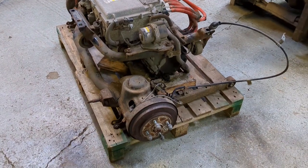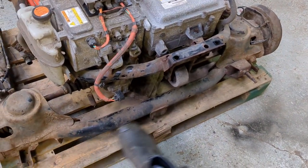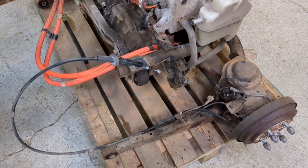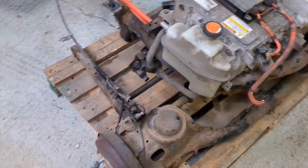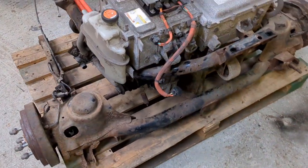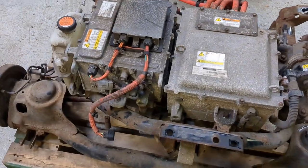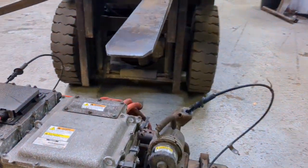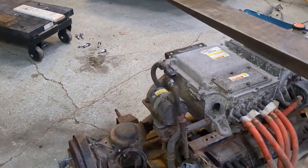The rear suspension — it's a rear-engined, rear-wheel-drive vehicle. The rear suspension is a De Dion axle. It's like a beam axle, but the half shafts go up to the diff, so it doesn't have the weight of a beam axle. It's got trailing arms which look a decent length. Drum brakes on the rear, interestingly enough — though you don't need rear brakes that much anyway. We've got springs and dampers we can do a lot with. On top of it we've got the inverter that drives the motor and the charge controller with the DC-DC converter. Underneath is where the motor and gearbox sit. All in all, it's a fairly tidy and efficient package — other than bracing it to cope with the knocks and shocks, there's not a lot to be done with it.